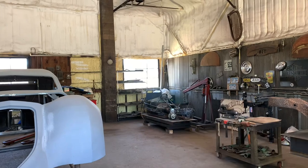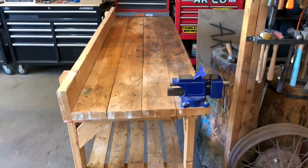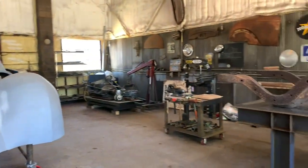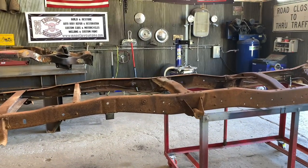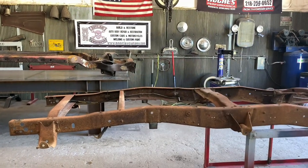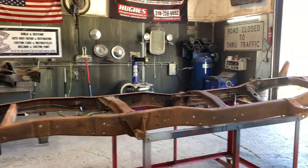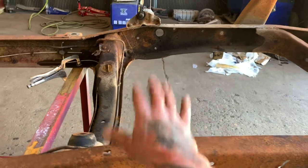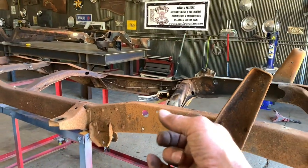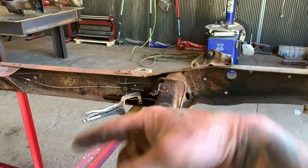In the meantime I want to move that shelf over there with all the metal on it now that I've got this corner cleared. I'll get this workbench put over there - it'll be nice. This frame is for that unibody - it's getting airbags and pretty much a mini tub in the rear, so a lot of work is going to go into it. It's got to get sandblasted, and I've got to build motor mounts, a cross member, and all that stuff for the small block Ford that's going in here with the automatic. This originally had the straight six inline six with the three speed, so I've got to pull this cross member out and build a new one. The shock towers can come off too.